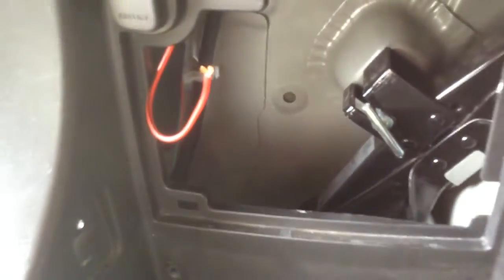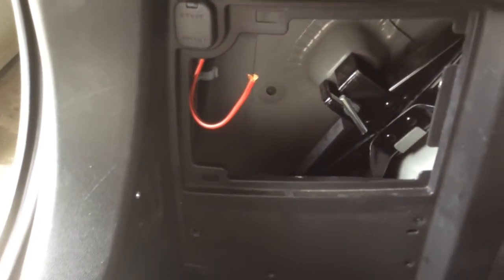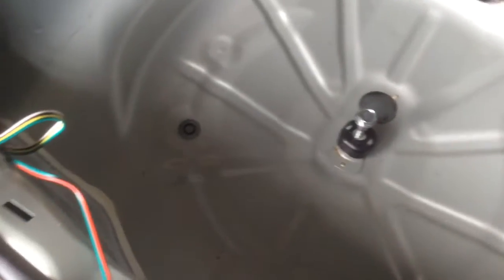And now I've just got to run the power line from the front. And to start from that, I've got to figure out where I'm going to leave the body and head outside. Plug patches, melt holes, and drains and grommets tend to be at the lowest point. So I pulled the tire and had a look, and it looks like we've got a candidate right here. You can have a look and see what that looks like on the bottom. Make sure it doesn't come out in a dead end, and then we'll start planning the routing underneath the car.